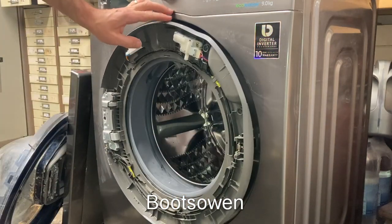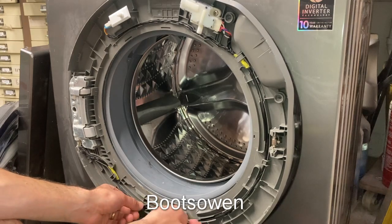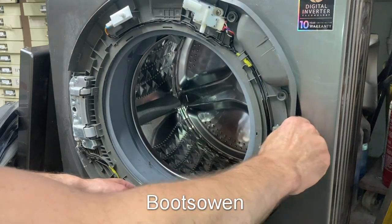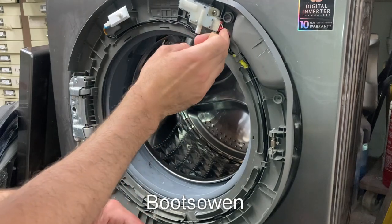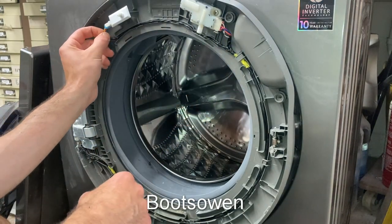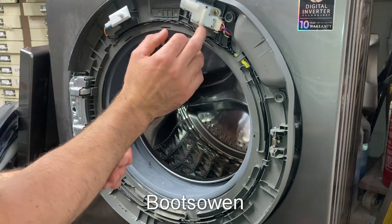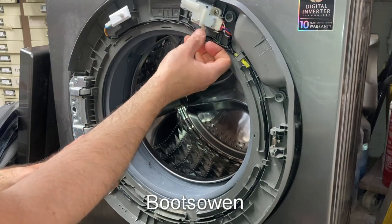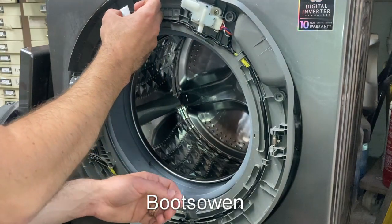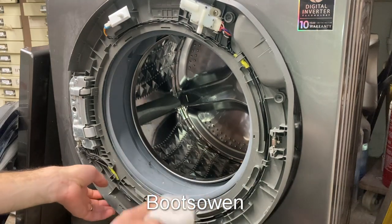What's going on with this door? Power's coming in down here through a cable, through the hinge. Running along, zigzagging in a wire. There's a clip there but it doesn't do anything — it's just the snap of the door. Wire comes up here; there's some kind of sensor. Five wires — two reds, blue, black, and white. Over here, two reds and a yellow. So this is some kind of sensor for that little inner door. It just seems to be a switch, actually, is all I'd say — very loosely connected. Little push button deal there. And this one again feels like a micro switch. I don't want to get into them; they're working and I don't want to break them.